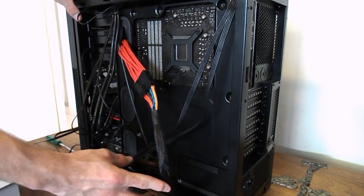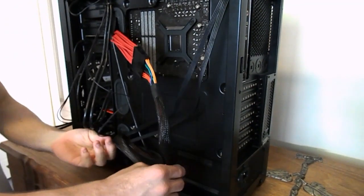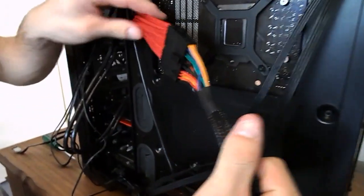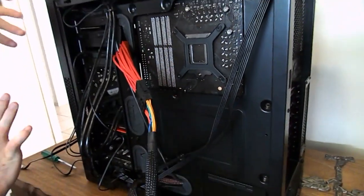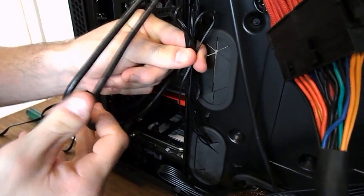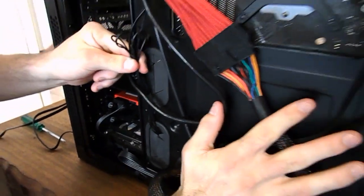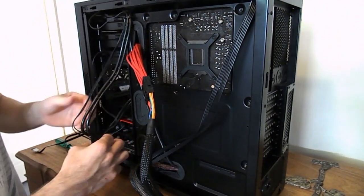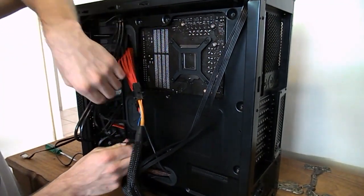On cable management, basically, you just want to come over here, use some zip ties, clean it up at the back. It's usually one of the more tedious tasks of building your own computer. It's just basically you want to get that back panel on there, guys. So just wrap those cords up. Some cases will come with nice tie down points. This does have a few, not as many as we'd like, but they're really easy to implement for manufacturers, and a lot of cases will have them these days. So just go ahead and use some zip ties or whatever, and just make it look pretty, and make it so that you can get your back on properly.